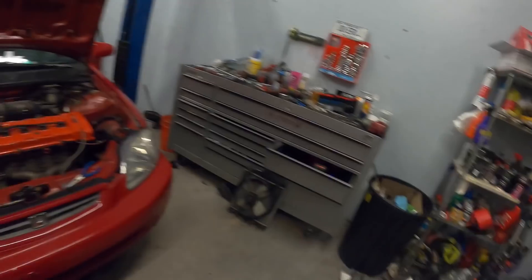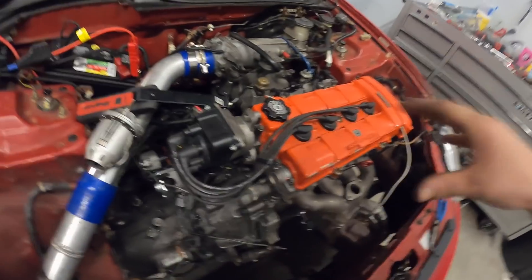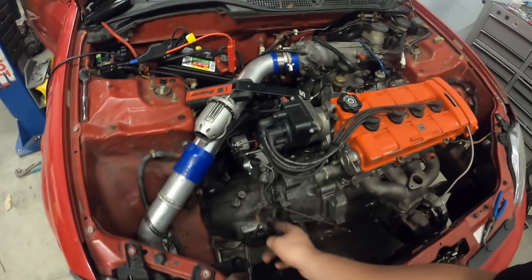If you guys like this video give a thumbs up, and subscribe for more. Hopefully tomorrow this thing is running - we're really grinding on this thing. We were here until 4 a.m. and we've been here a good seven hours today trying to figure this out. We used the voltmeter with the impedance setting, went around unplugging everything to find the short, and the last thing we unplugged was the starter and the noise went away - that's how we diagnosed it. Anyway don't forget to check the description below, and I'll see you guys tomorrow with another banger.